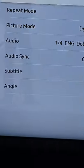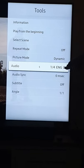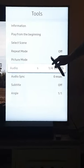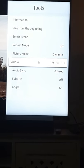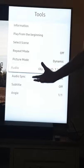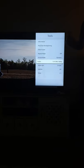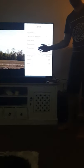Go to Tools on your DVD remote if it has it — you'll see Dolby True HD 7.1. Now you're thinking that should say Dolby Atmos, but here's the trick: that's coming from the TV and it's saying 7.1 channels on Dolby True HD — that's where I got caught out. So the trick is: take the HDMI 1 that's in the back of the TV, unplug it from the DVD player, put HDMI 1 into the back of the soundbar, then plug that into the DVD player. The picture will still come through because the soundbar is acting like an AV receiver — that's how you get Dolby Atmos.